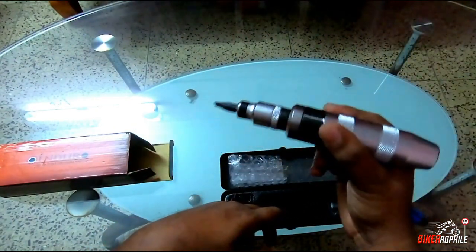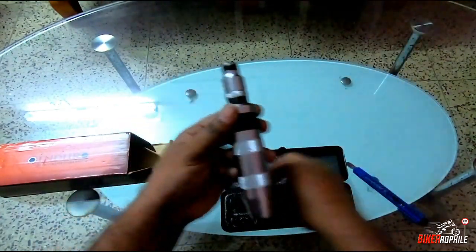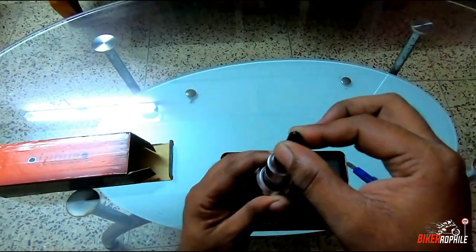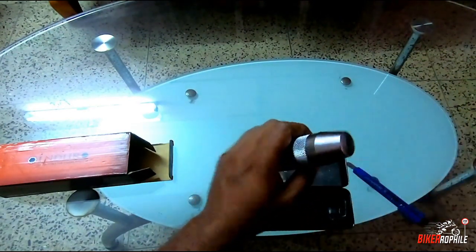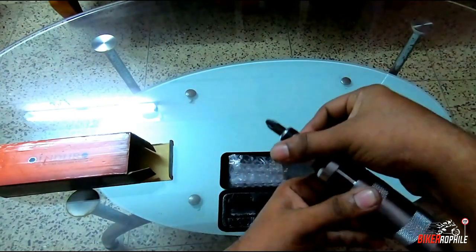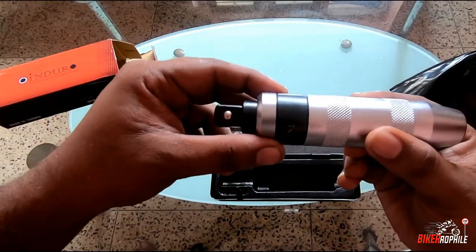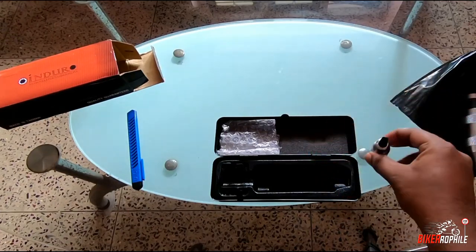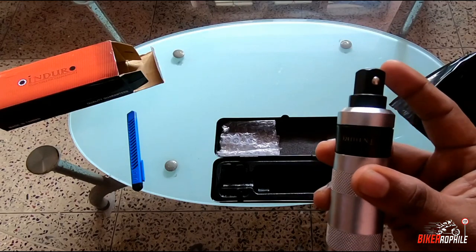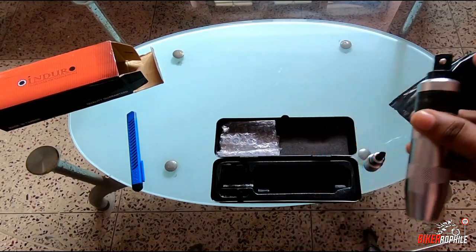In those situations, what you do is take the Phillips head bit, put it in the socket, and give it a whack with a hammer — that force will twist and extract the nut. It's a great tool for removing rusted screws and rusted bolts. It also comes with a half-inch square drive, so you can use your regular half-inch sockets along with the impact driver.